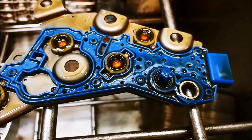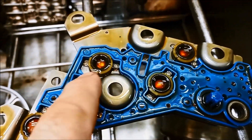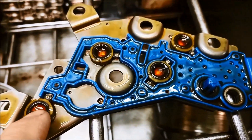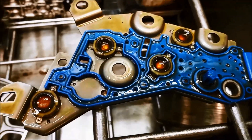And there we go, that's what it looks like. You just want to make sure that all these little pressure switches haven't got fine metal in there — this one looks pretty clean. And there are the little o-rings; sometimes they get stuck on the valve body. You want to make sure they're on the switch plate when you're putting it back on.